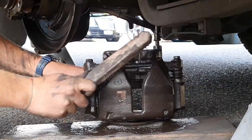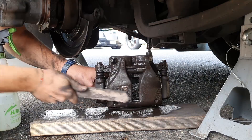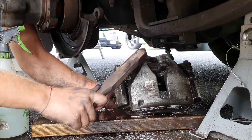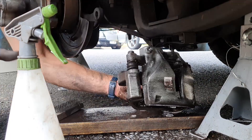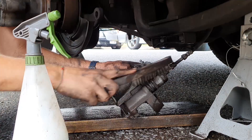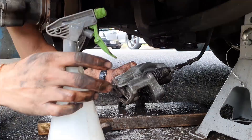There's a drum brake inside the disc of the rear axle — this is only the parking brake, the handbrake, and it doesn't get engaged while you're driving. You should check to see if there's any material left on the shoes, but these wear very, very slowly so you should be fine. You don't need to change these very often. It's more important to clean out the assembly with some soapy water and a toothbrush to get into the hard-to-reach places. Also make sure to check the springs so they're not rusty or corroded. Since our discs were fine, we didn't have to change them or adjust the shoes by turning the star wheel with a flathead screwdriver.